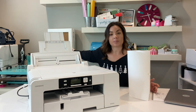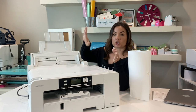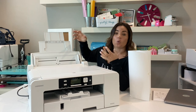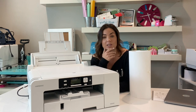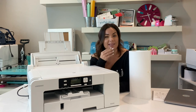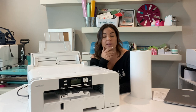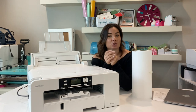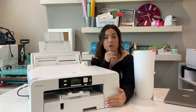Keep in mind that while you can print up to 51 inches long, it can't be from a roll. You can stick with 13 by 19 sheets, or buy rolls and cut them down — it's a more inexpensive way to go if you're printing a lot. You can make longer, wider jobs or more jobs at once, but you can't print straight off the roll like you could with an Epson F570. Now that the bypass tray is set up, we'll do more tutorials — instead of picking the tray option when printing, just pick bypass tray.